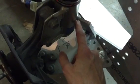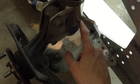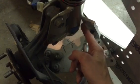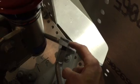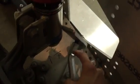We have barely any clearance here. Please check when you get your car — if when you put the wheels on and put the car on its weight, if this rubs. If it does, take an angle grinder to the corner of this bracket. You actually don't need this bracket top at all; you can even cut it off. Leave enough room for a one-inch diameter around this bolt head on both sides.